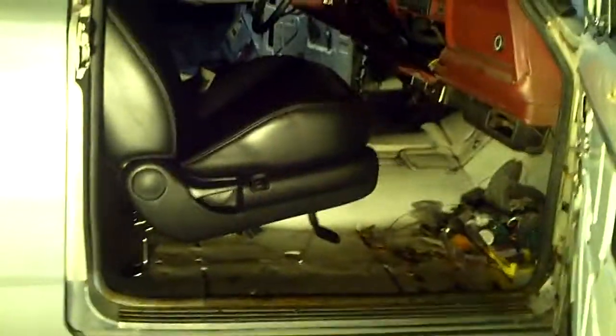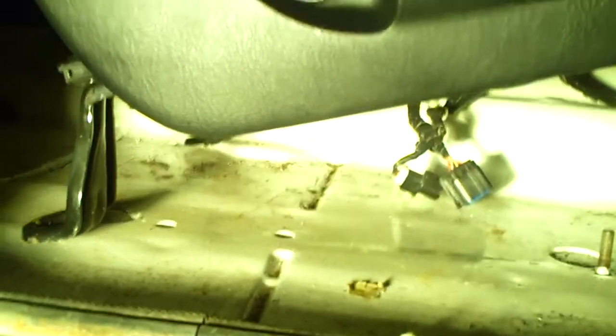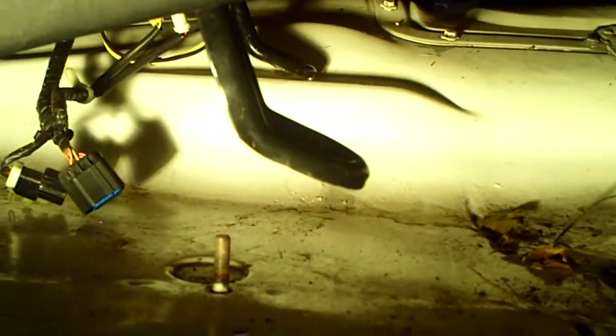Now here's the problem if you're considering swapping out into another pair of seats from another model or make of vehicle. In the back I'm not too worried about being able to weld in some studs there for the back of the seats to mount up to. But in the front we've got a wee problem — the transmission hump right in the center doesn't want to help the cause at all. I'm going to have to cut that bracket down and maybe splay something in there, otherwise I'm going to have to cut out a slot of that transmission hump. I really don't want to do that, although other guys have done it with some success and it looks pretty good.